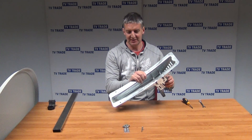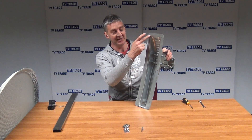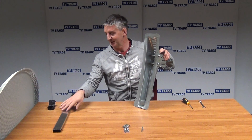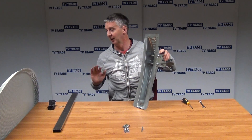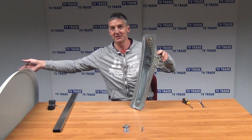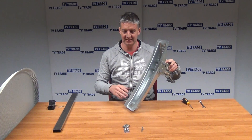This all obviously bolts on the back of the dish. How it's going to be bolted on is there are six holes here, and they exactly line up with six holes on the dish. We also have this arm here which will bolt on, mount forward, and it'll be used for holding the LNB, which picks up the signal and runs it into your satellite box — so it'll be a certain distance away from the dish.